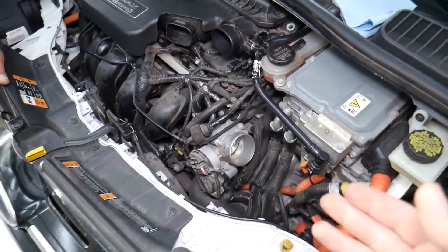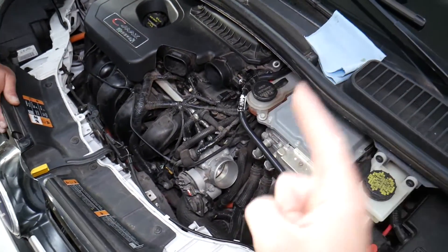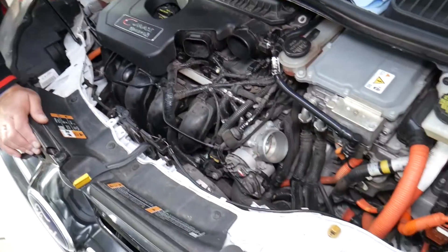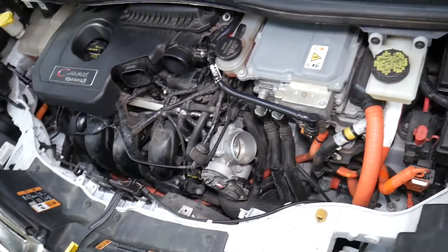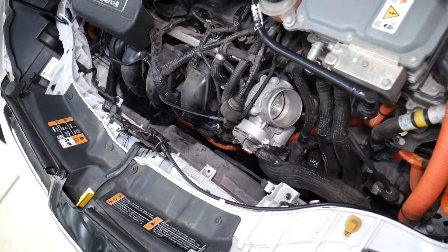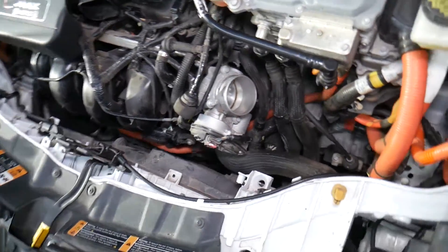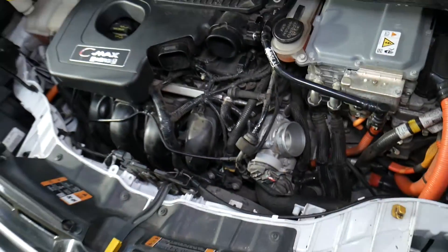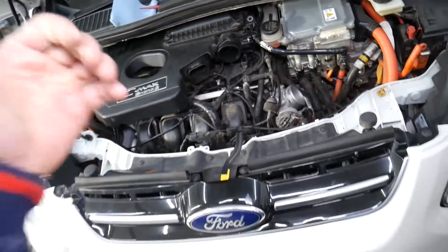Number five, it could be a bad car computer — though in some cases that's rare. We had that happen only one time on a Jaguar vehicle back when Jaguar was built by Ford. We had to send the computer for a rebuild and they fixed it. But most of the time it will be either a relay, fuse, control module, or the fan motor itself. Hopefully this video will be helpful. Thank you for watching — see you next time.